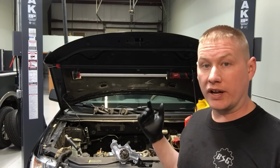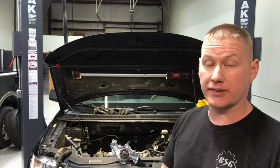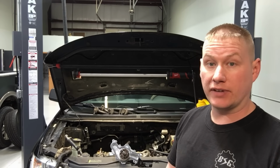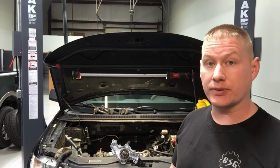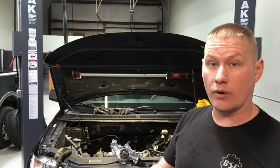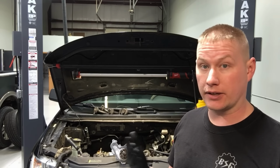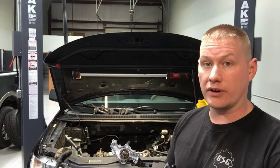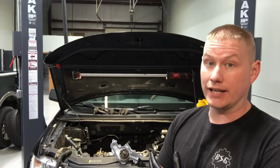Today we're working on a 2010 Ford Edge that has a lot of miles on it, like 185,000 miles. And we're preemptively changing the chain-driven water pump because the customer's getting some Blackstone readings back that may indicate coolant is getting into the oil and basically destroying the bearings. They get higher metal counts and then they assume there's coolant in the oil. So we're changing it out preemptively. I say by now, 185,000 miles, it's due.